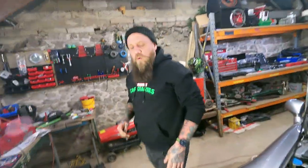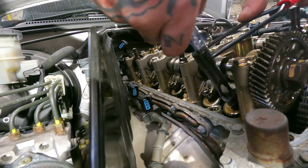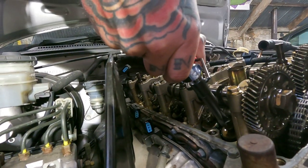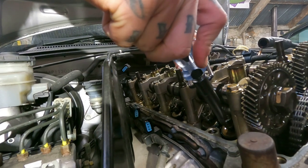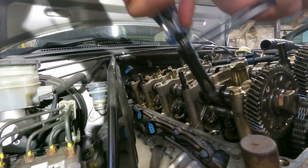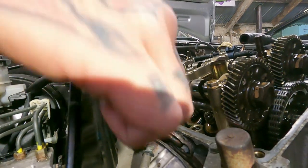So we want to loosen them a smidgen basically. So you put this on, hold onto the screwdriver, turn your handle, and that loosens it off. We were too tight, so we want to loosen it off just a touch, keeping the screwdriver in position, then tighten the nut back up — job's a good one. Then have a little feel, take your feeler gauge again.